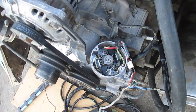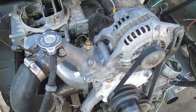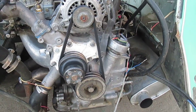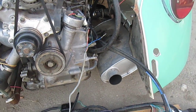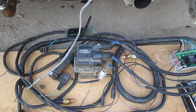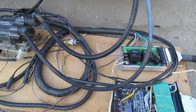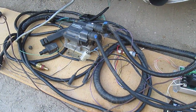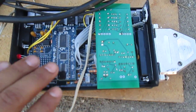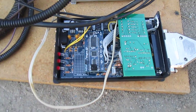Surprisingly enough, it actually does run with the carburetor on there, so I knew for sure it was going to run with the carburetor and the original distributor. So I went ahead and tried to get it to run with the crank angle sensor and the Megasquirt, and sure enough it finally worked. Took a lot of trial and error adjusting these pots here — one there and the one there — but finally got it running.